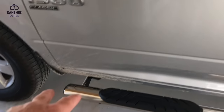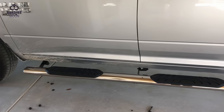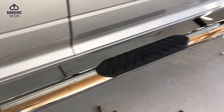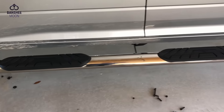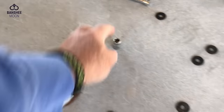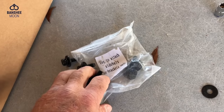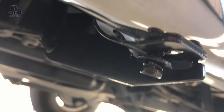I have my small end forward and my long end to the rear, and everything fits. Be careful — in doing this you could drop your sidestep and damage it. I have one bolt in and now I'll start tightening everything up. I'm going to be using a 13mm and a 10mm socket. There's also a bag labeled 'used to attach sidebars to brackets only' — those bolts, already fitted with washers, go up under here and secure your sidebar to your bracket. Simple enough — two, four, six bolts, with the same on the other side.